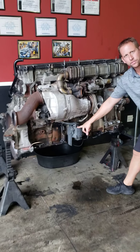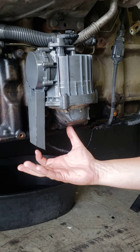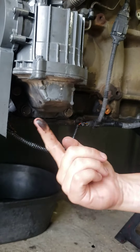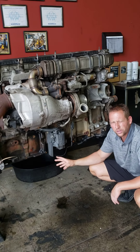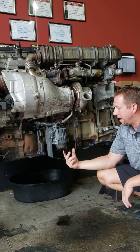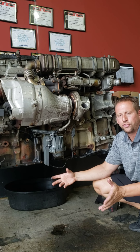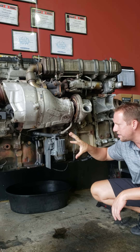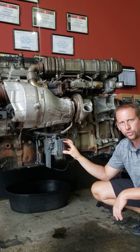This right here is called your crankcase separator or crankcase breather — there are a couple of different names for it. The most common failure is oil pouring out the bottom of the crankcase filter. If you've got oil all down the back of your truck, all down your oil pan, when this starts to leak, it's time to replace it. Another reason is if you get a fault code for your crankcase separator speed too low — the internal turbine has either seized up or is not spinning correctly. It needs to spin about 5,000 RPMs, which you won't know unless you have Diagnostic Link hooked up. 95% of the time it's the crankcase breather, not a sensor or harness issue. So if you've got oil coming out of it or a check engine light, go ahead and replace it.